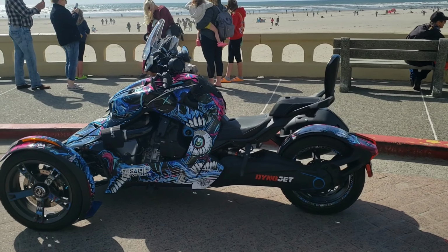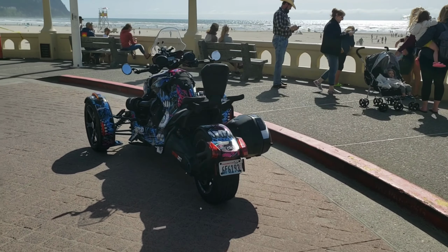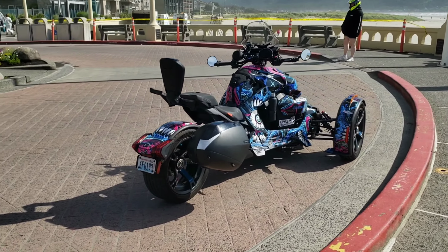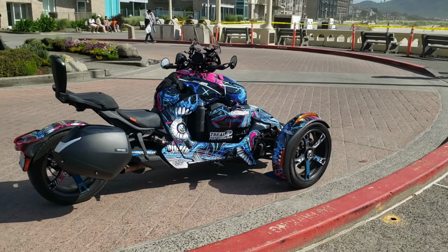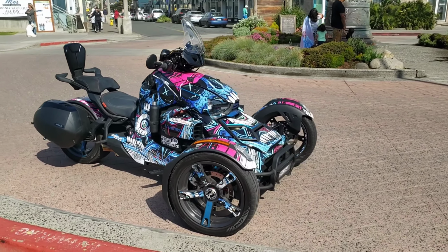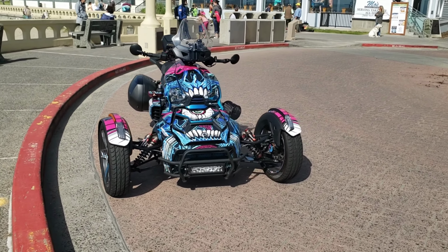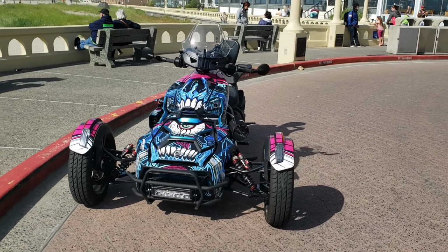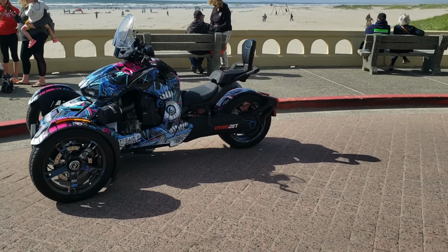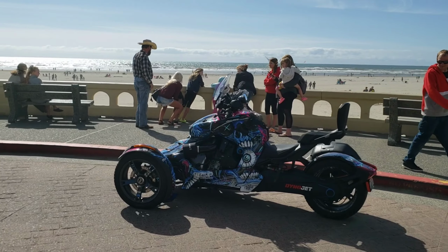Today I'm going to be going over the right hand side air filter, which allows air to come into the CVT transmission. So this air filter will have 5 8mm bolts holding it in. There's 2 on each side as you open up the right hand side panel, and then there's one down towards the bottom. The one down towards the bottom, you can get away with just loosening it and not taking it out all the way, as it is hard to get to. So just follow along in the video and you should be able to change out your CVT transmission air filter.